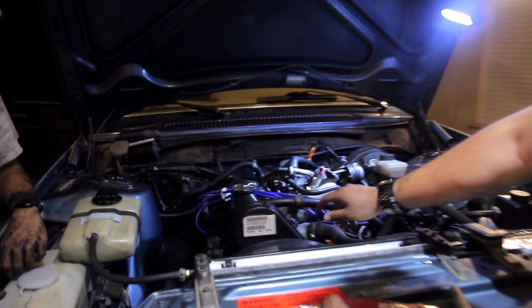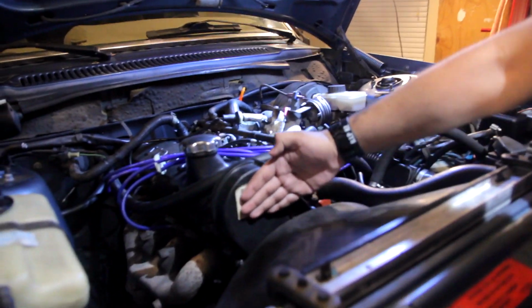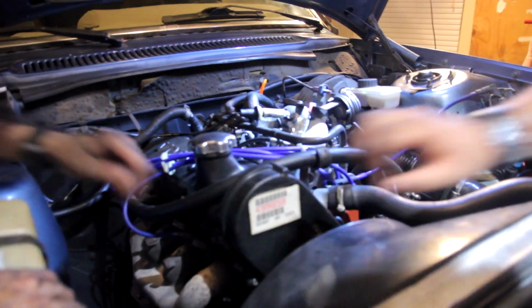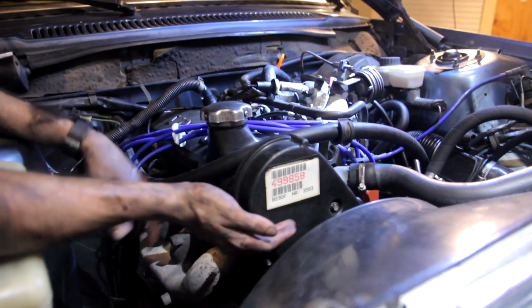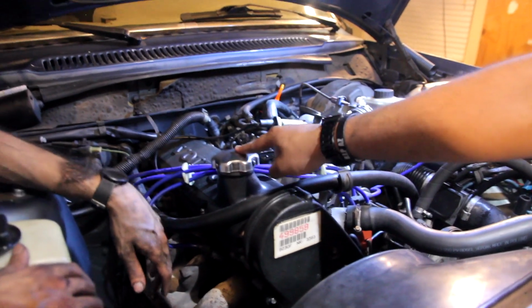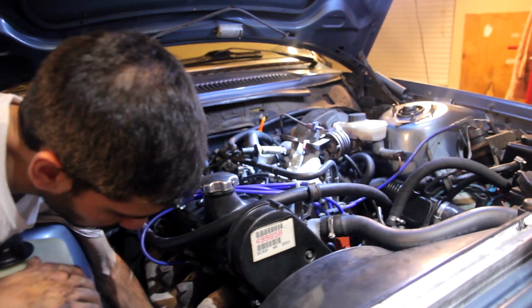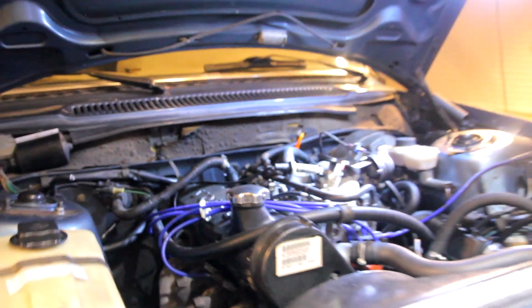Yeah. The engine is, as you can see, so this sticker basically used to be at an angle here. The whole engine used to be kind of more or less down here. And now it's actually lifted up. Yeah, I remember this cap was cocked that way. Yeah. So now it's all straight. And there's full clearance to the oil filter. Right. This used to rest on the broken mount, and now it doesn't. So now we can change the oil without having to have a strong friend, hi Jake, lift an engine.